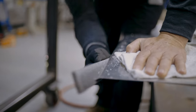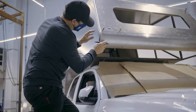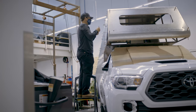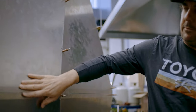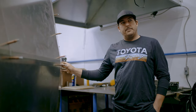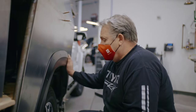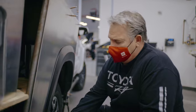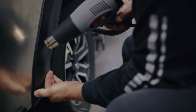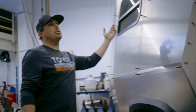We have gotten a lot done on this camper. It probably doesn't look substantially different, other than we have the roof skinned, we have the rounded corners skinned — which is a process as well — and then we have kind of a body line coming through here. Getting these to all line up takes a little bit of time and patience. We're trying to make the stock Tacoma fender flares fit on here well. We wanted to keep the width in the middle of the vehicle and narrow it up for the trails on the top and the bottom, obviously for tree avoidance.